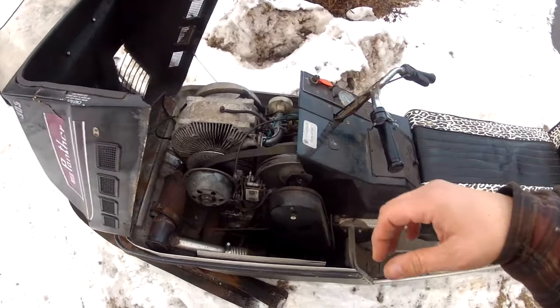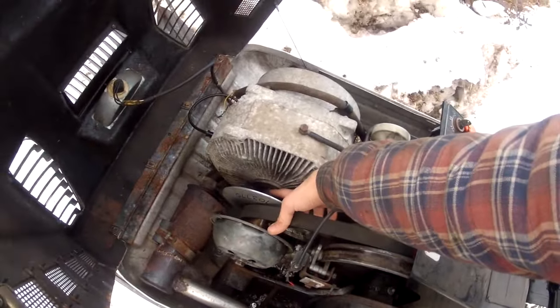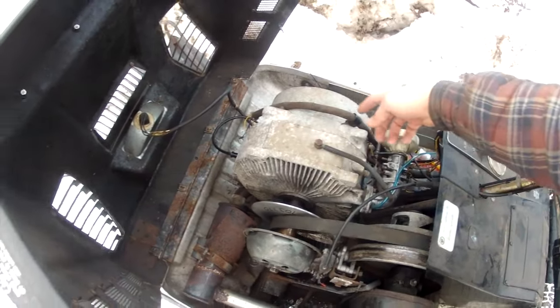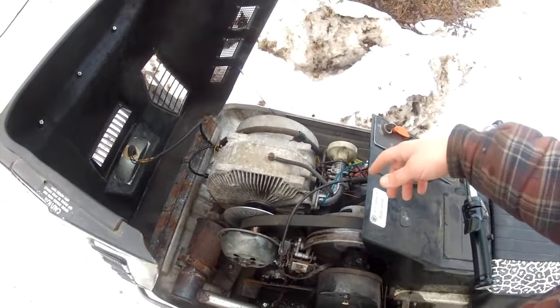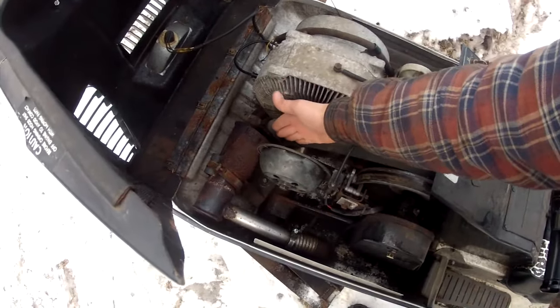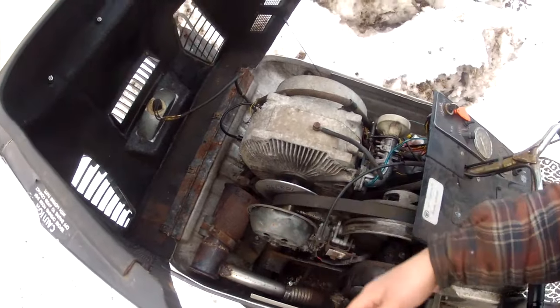There's also an O-ring. If we look at the back of the clutch, the crank seal is right there like you'd expect, but there's also an O-ring just in here, and kind of similar but not the same size on the other side. The other thing I found was that the clutch — the stationary part of the clutch — was broken right there.